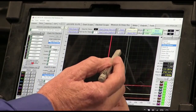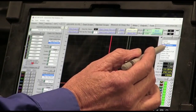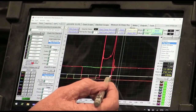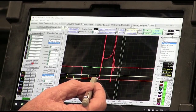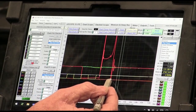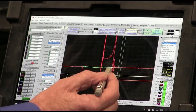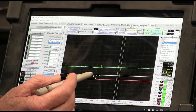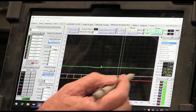Again, we start loading it. It's got a lean look, like it's lean. And you can see right here where we had a lot of energy. Do you see how the reserve, this is the energy being reabsorbed into the coil. There's a lot there because right here is my pull down and I'm going below that. And so this took a pretty good hit. It's trying to fire and it's having a hard time firing. And when it has that hard of a time, we can see that in everything. You can see that spike all the way through.